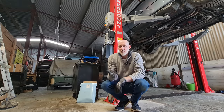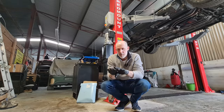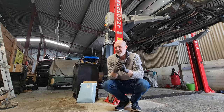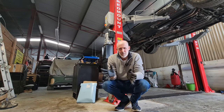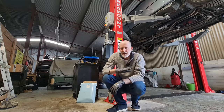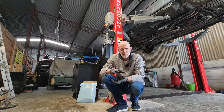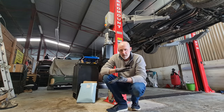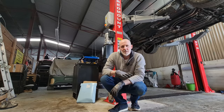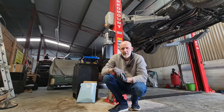This has led me to the conclusion that I want to get both heads rebuilt. To do that, the engine essentially needs to come out. It'll also give me more access to the engine bay, because there are some rust repairs to be done there as well. If this is going to be a full restoration — bodywork, exhaust, suspension, brakes, the whole thing — will I really be happy with the level of work I've done to the engine? The inside hasn't been looked at. The compression is good, but the top end has a big question mark over it. Now's the time to do it — get the engine out, get at that engine bay, and send the heads off for a professional rebuild.